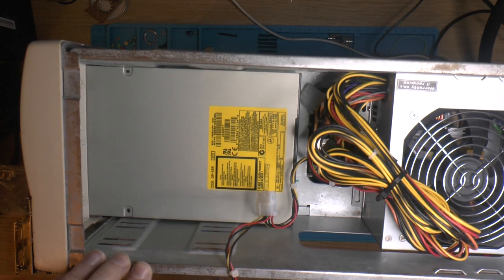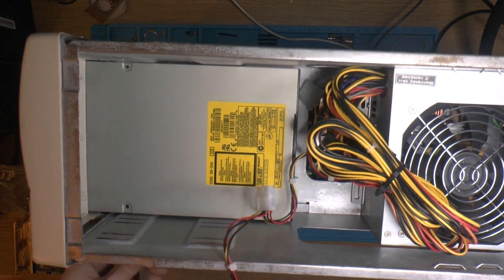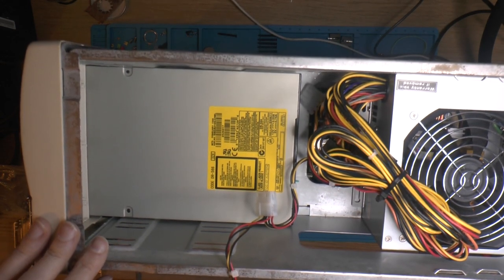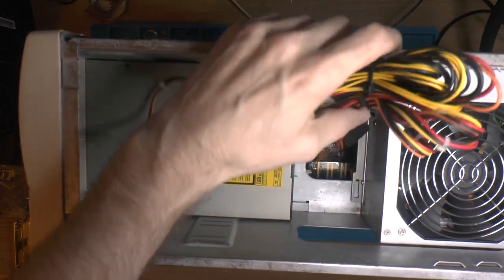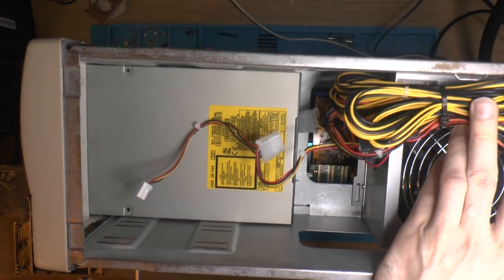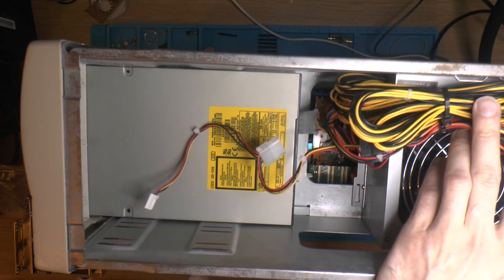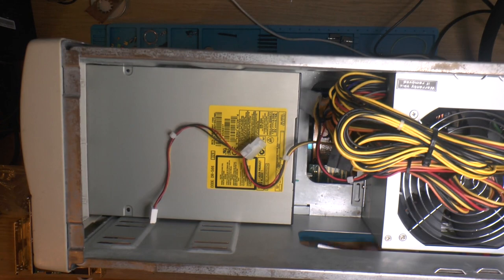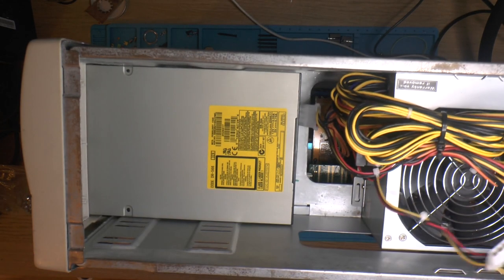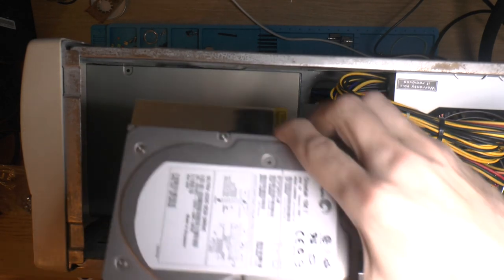You can see the power supply has the grill facing upwards — before the time of 120mm fan power supplies. There's a big opening at the front and the air coming in will go through here and out the power supply. That should work well enough for a machine of this low power output — we're basically using a mobile-class CPU. I'm routing power to everything now. For the SCSI cable, this is a 50-wire flat cable with a twisted section — that twist pattern has to do with avoiding data corruption, similar to how network cables work. The connectors on SCSI cables can be quite tight.